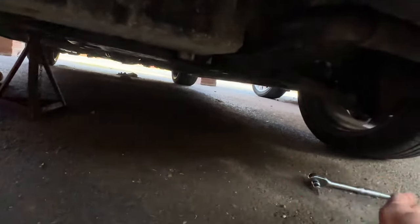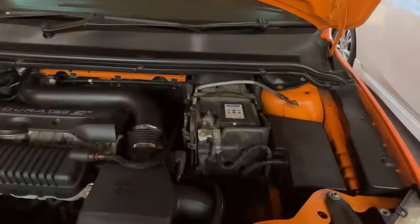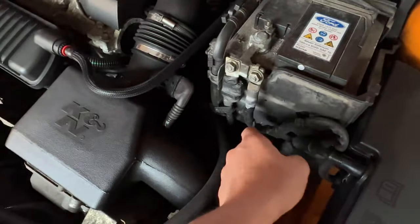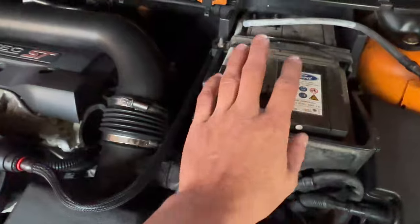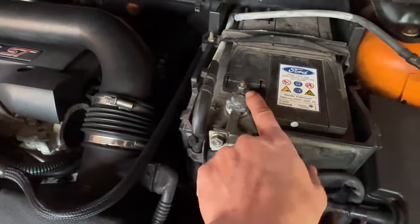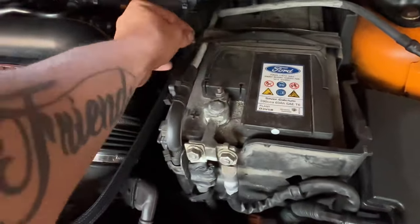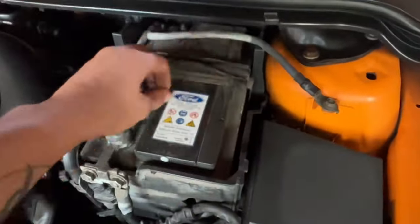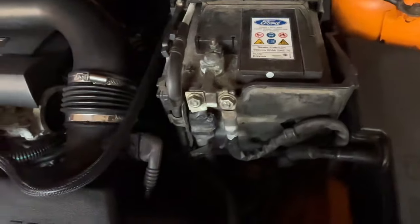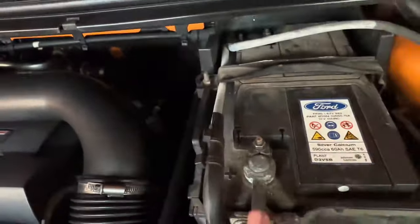Right, that's done. Now to get to the top side — I'll pop the bonnet and explain further. I've taken the top cover off the battery because the gearbox reverse switch is down here, so I'm going to take the battery off and take the tray off too. There are two 10 mil bolts — one there, one at the back — then unplug that, take off this mounting bracket, and pull the battery out. I'm assuming there's a specific way this tray comes off but I'll figure that out once I've started undoing things.